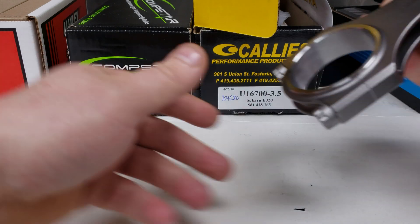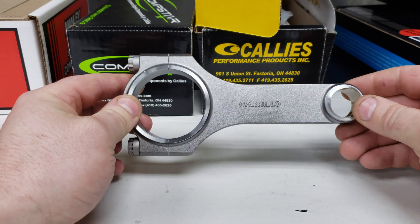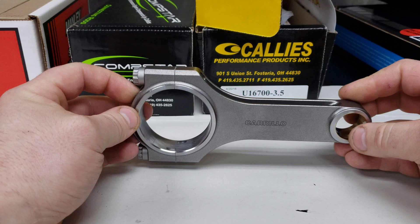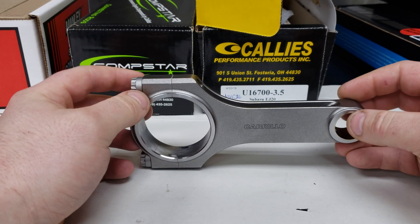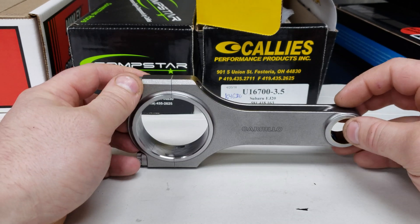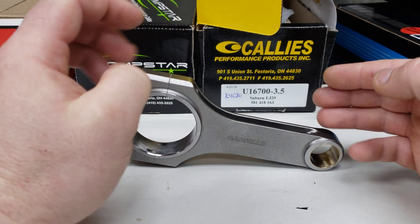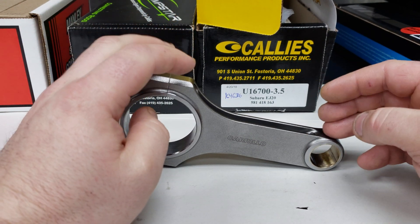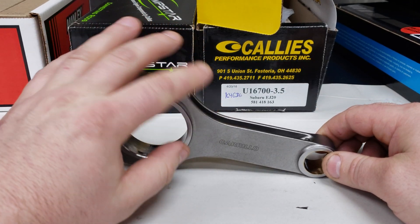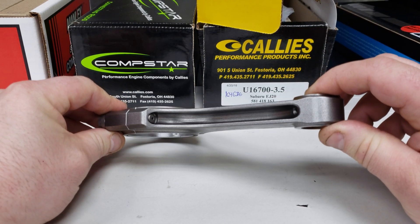Now what we're on is a custom-built Carrillo HD. This is the only H-Beam on the market that's rated for the kind of power that we're putting through it. They rate it for 350 horsepower per cylinder and a lot of torque. When I asked them about this rod, they said they find with the short rod lengths like this, being 5.216 inches, that this design is better at taking torque and not buckling in the area above the big end of the rod. Take it or leave it, that's what they told me.